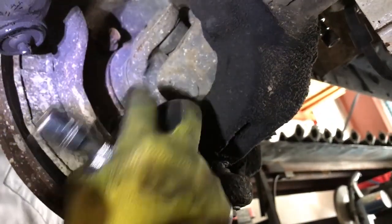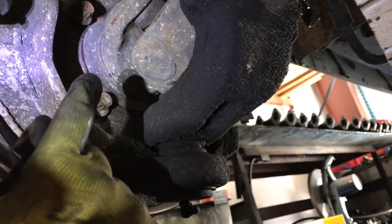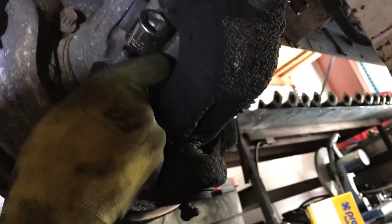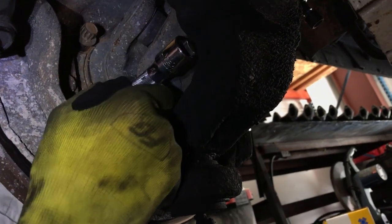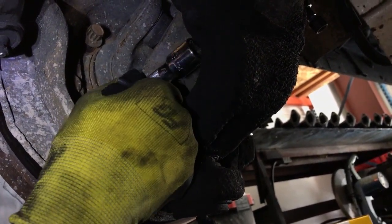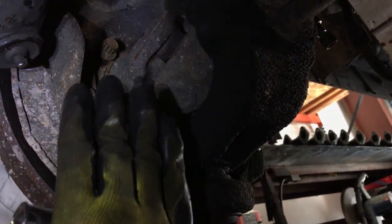All right, here's a little trick. Now we've backed these four bolts here, here, and the two on the other side off about an eighth of an inch. That's about that far. And the reason I go that far, you don't want to go further than that at this point. What we're going to do is the socket, the extender we use to put in there, I'm going to touch on the bolt and actually tuck behind the casting right here.